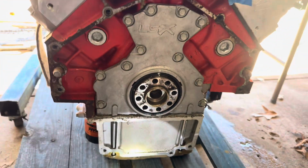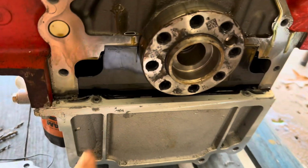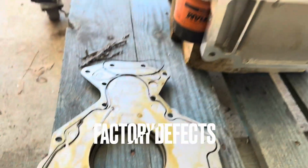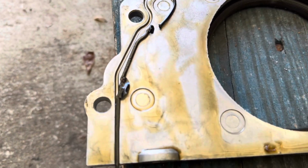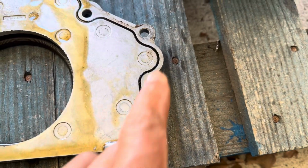Okay, well, off with that plate. Okay, back to it. I just cleaned all that sealant off that platform that I have right here. But this is the back of the engine, the LSX engine, and this is the plate that I removed. So right there, automatically what I've seen is that rubber gasket being pinched already. That's why you see that flat part right there, and it actually broke, and it's pinched right there. It's actually supposed to be straight in just like that.